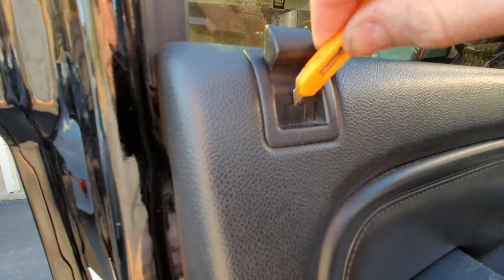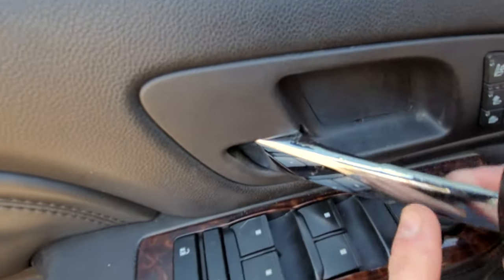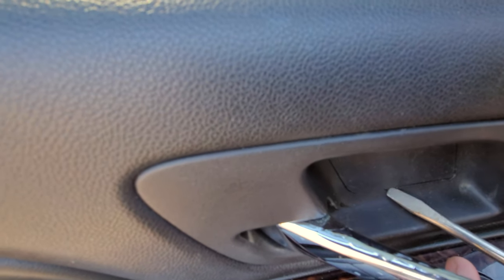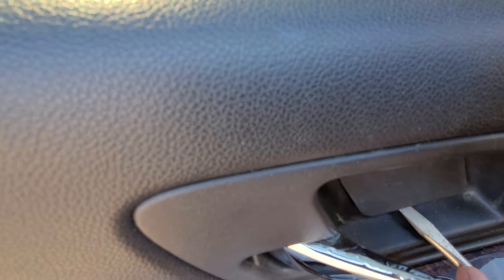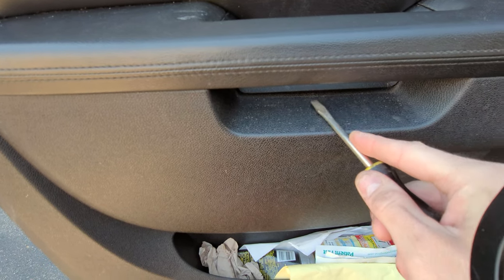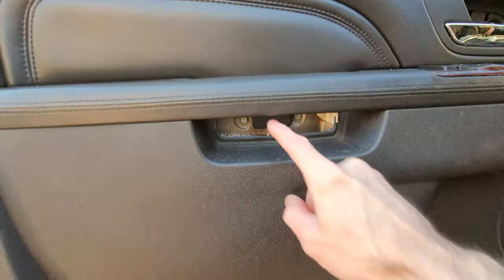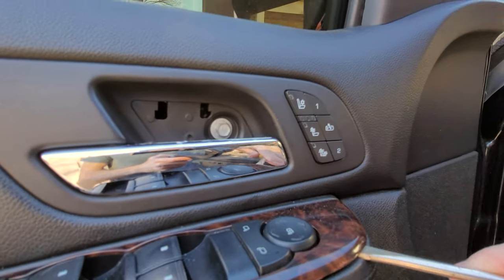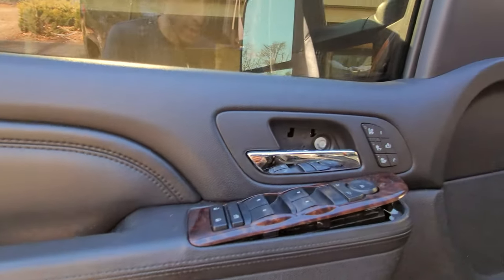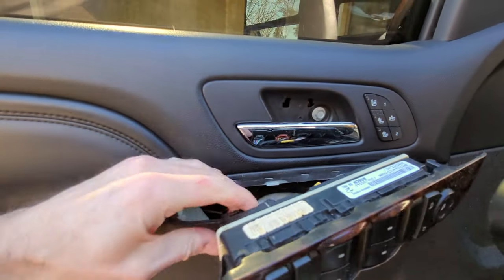I'm just going to get behind it gently. The guy who owned it before me did it very rough because there's like a little indent there. Going to pull up completely — you don't even have to disconnect that all the way. The door handle — much easier, might I add. Put a little flathead screwdriver gently and pull up and away from the door panel. It just comes right off. As long as you do it with the right amount of pressure, it just comes right out. Removing this one is the same thing — just put a screwdriver in here and pull up gently. It's firmly in there but it comes out once you pull up on it. You can see there's two screws there, so all we're going to do is remove those two screws. Now we're going to remove the door control panel. The only thing we really have to do is remove those bolts and then pull on the clips to pull the door panel off. You want to use a plastic pry tool, not a metal one — otherwise you could damage something.